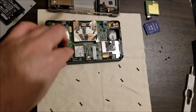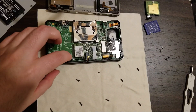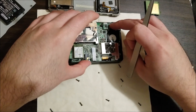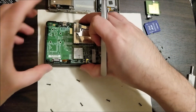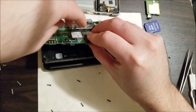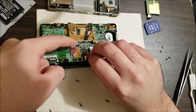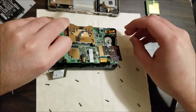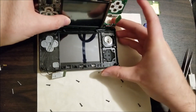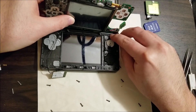Things to be careful of: the microphone here. You are going to need to carefully pull it out of the little rubber sock — it goes into the case. Just pull that out slightly so it's still connected but you can get it out of the way. The board is pretty much loose now. There are three ribbons connecting to the top half, so we just have to be careful. You can put your finger in, open it slightly, put your finger on the touch screen and gently push it out. There is also a ribbon going for the Wi-Fi, so just going to move that out of the way and totally lift off the Wi-Fi card to get access to it. The volume control, just wiggle that out, and you want to be super careful not to flex the ribbon cables for the top half too much.